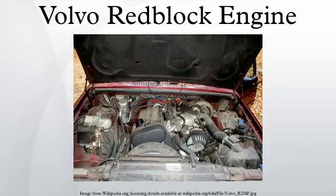Another cause for timing belt failure is improperly adjusting the timing belt on engines with a manual tensioner, or improperly adjusting the balance shaft belt. Because this is an interference engine, damage will occur if the timing belt fails. Another common occurrence is that the balance shaft's oil seals are prone to leak on older engines. New replacement seals tend to start leaking again due to worn-in irregularities on the shaft itself. Many people have removed the balance shaft belt or the balance shaft assemblies altogether to prevent belt failure and or leakage.